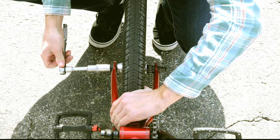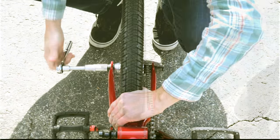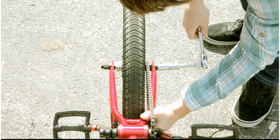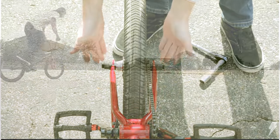You should also take the time to check your wheel alignment. If the axle is bowed or forced over in the dropouts, this can cause unwanted stress to the clutch and driver bearings. Don't force the wheel center — allow the wheel to center itself in the dropouts.